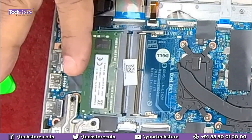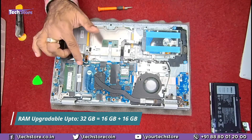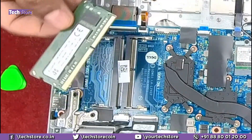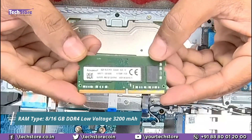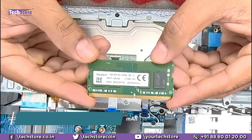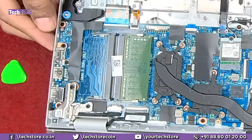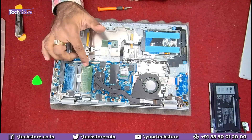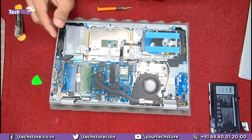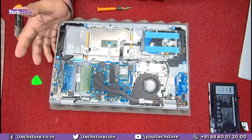The RAM area has two RAM slots, so the maximum RAM upgrade capacity is up to 32GB — 16 plus 16. To remove RAM, use two thumb fingers on the clips and it comes off. You need DDR4 3200MHz low voltage RAM — 8GB or 16GB per stick. The 8GB variants come with one stick installed, leaving one slot free for upgrade. Best practice is to have even RAM across both slots — 4+4, 8+8, or 16+16 — for efficient read and write speeds.